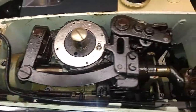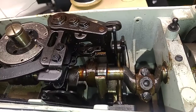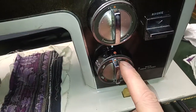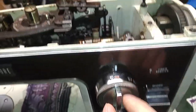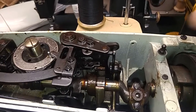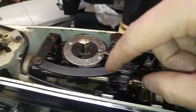So I want to go over this whole reverse mechanism train. We already know down in here that clunky sound the machine's going. But what's triggering that when we're on these reverse stitch settings? I'm going to switch this over to S, M, or L — pay attention to this little lever right here. Switch it over to M. It's L, M, and S, and there's probably some kind of travel. What's going on is this is now going to engage with this lever.